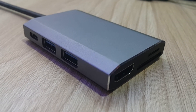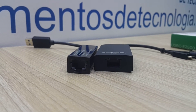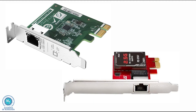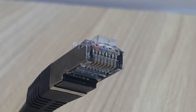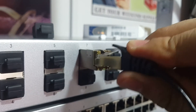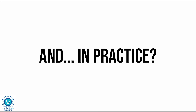If you need to upgrade a desktop computer to 2.5 gigabit Ethernet, you might want to consider a PCIe network card — we'll leave links in the description or our Amazon storefront. You'll also need category 6 or 6A cabling; we recommend category 7 if available, though long runs can be expensive. We're going to connect everything to our switch and start our tests.